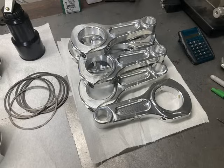And you know, a lot of people don't like to run aluminum rods on the street. A lot of people do run aluminum rods on the street. And with new technology and new billets and that sort of thing, there's a lot of people that run them on daily drivers as well. So I think times are changing for aluminum rods, and this will probably be something that I will look into a little bit more further on street engines and street strip engines. They do have their drawbacks. You have to make allowance for them growing with heat, as with anything aluminum.